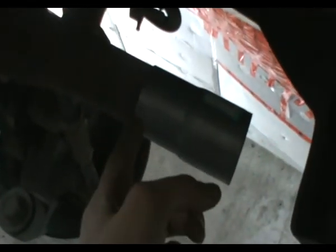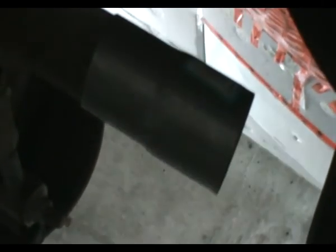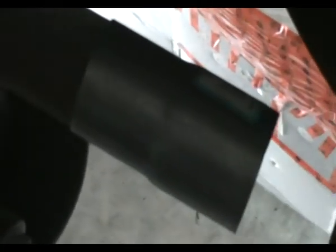And what do you know — it fits perfectly! So just so you can see how it's going to look: I'm going to weld this right here on this pipe, and then the muffler will go inside here and I'll weld it from here as well. So you have two welds to do, all around of course. And then it's attached — we'll do the same thing on the other side. As you noticed, I removed the tire for better access in cutting.